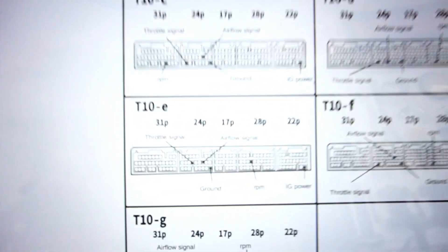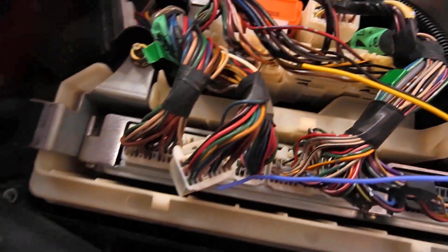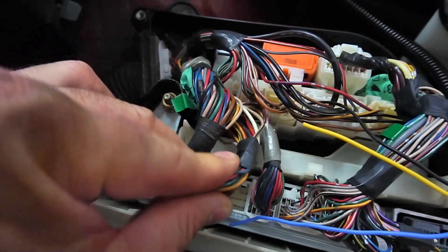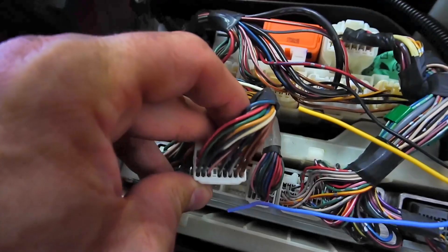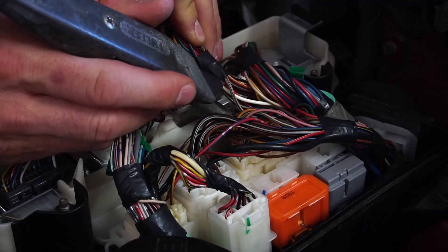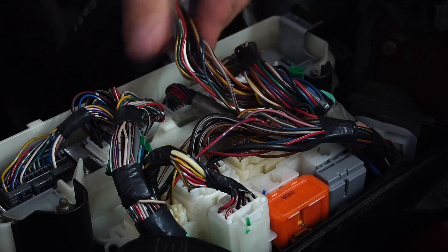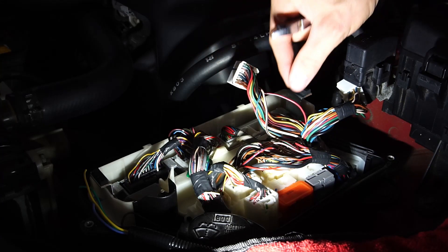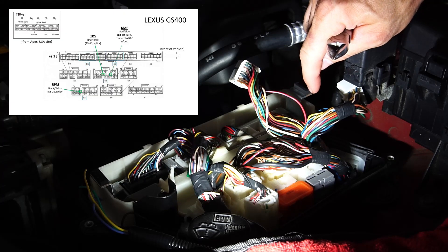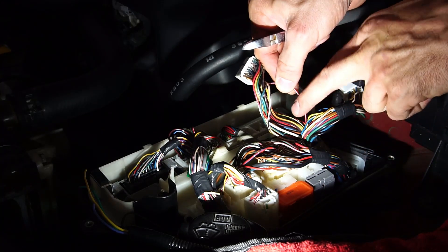On the Apexi site I'm going to use the T10E pinout, so let's focus on the 24-pin connection first. The best thing to do is slice the tape holding the wires together so you have a better way to see where the pins are — be really careful doing this. The MAF signal wire is the red and blue wire on the GS 400 on the 24-pin connector, listed on the T10-E wire setup in the Apexi USA instructions. This is the only one we're actually going to cut.